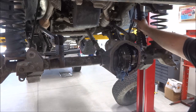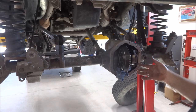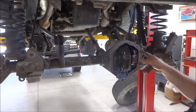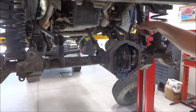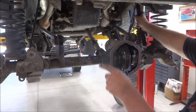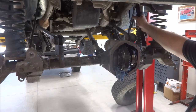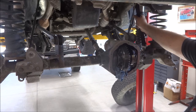my axle straps. So I'm going to hurry and pull the carrier, just because it's sometimes easier to pull the carrier out rather than wrestling it around on the bench. So I'm going to pop the caps loose, pull the carrier out. More than likely I'll pull the pinion out here as well. So basically I just get a bare housing, and then I'll lower it down a little bit onto some jack stands, pop my axle straps and my control arms loose, raise it up away from the axle and pull the axle out. Then I'll put the new one over on the bench and get these cleaned and start setting up